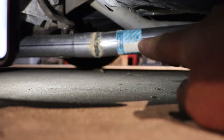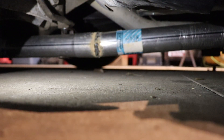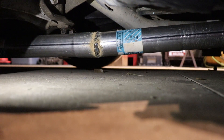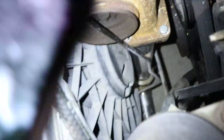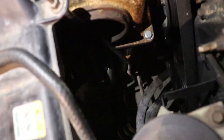We're gonna have to rethink from here forward a little bit, and I kind of already have an idea of what I'm gonna do. Right here is where the On3 would go through with a tubular K-member. I was thinking I needed a tubular K-member to build my own, but in reality it's still about two and a half to three inches from the ground right here. If I can kink that up a little, bend it up a little, I think that would be okay. Where it bends right there it's not connected — that pipe I'm gonna have to go a different route and angle it up, as you can see that pipe comes up to the turbo.